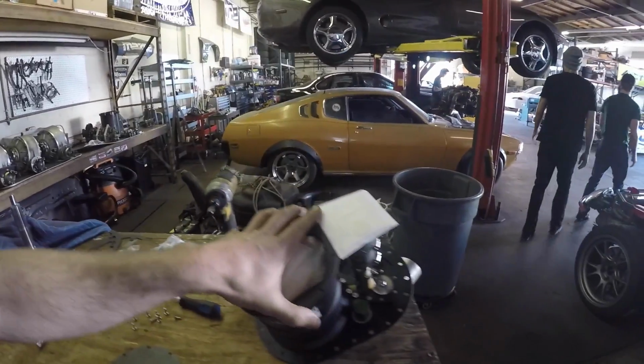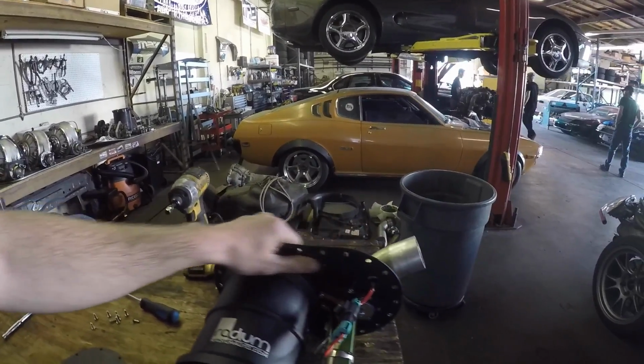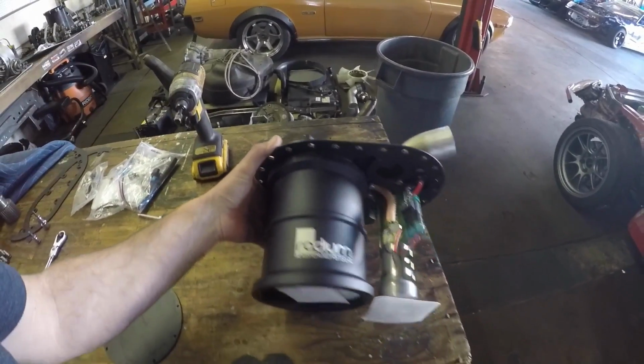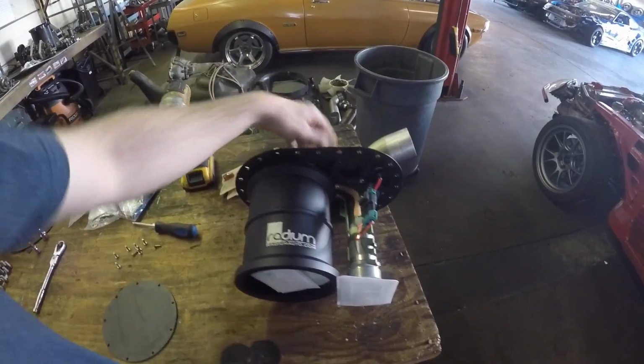This one will go in the backup Supra, and we're gonna put a new system with even more pumps in the Pro car. The reason we're putting more pumps is not because we need more pump, but in case one were to fail, you know that two are running all the time and the third one's just sitting waiting, and if one fails, you unplug and plug the other one in. That is a good thing to have for a competition car, because sometimes you get a 5-minute timeout if something goes wrong, and hopefully in those 5 minutes we'd have figured that out and get right back on the track with fuel pressure back up. That's if we had a failure. I've yet to have seen one of those pumps fail. So anyways, okay, moving on. I will talk to you guys soon.